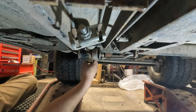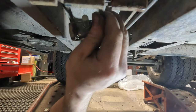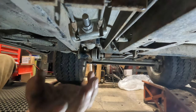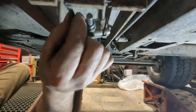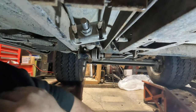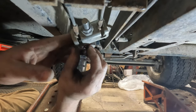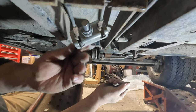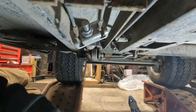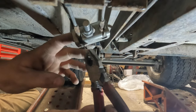Okay. Brake pedal is still moving freely. The brake cables are all the way back, because when I adjust the brakes out, I will tighten this up later, because I got to pull the back tire so I can adjust the brakes. But you need this to be loose, so that way you're getting your full motion of the brake pedal and brake cable, and the shoes are moving. Everything's got to move in concert. It's a very important thing.